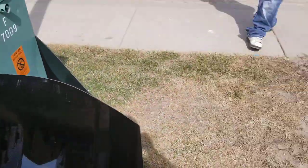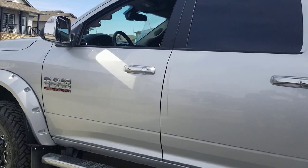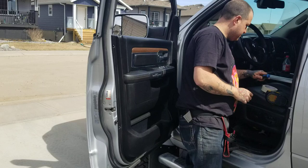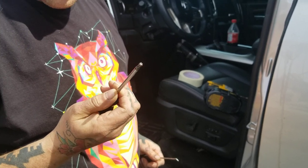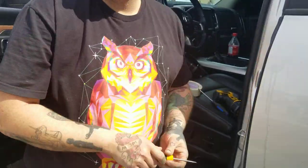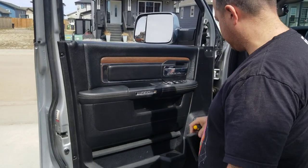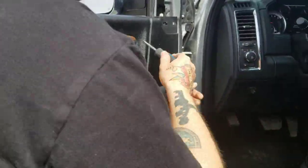That's the factory tinted window as you can see on the bottom where it'll be in the door. Tools you need: some masking tape, a T25 or so Torx bit, a pick, a 5 millimeter screwdriver. These panels come off from the top — make sure you don't bust those clips off. This little panel here comes off from the top and you'll also need a regular Phillips screwdriver.